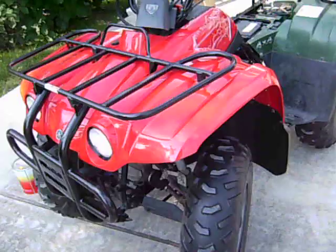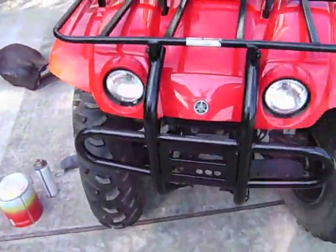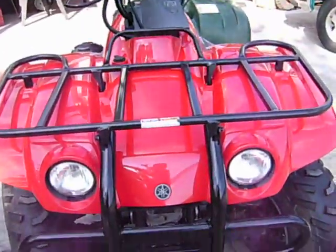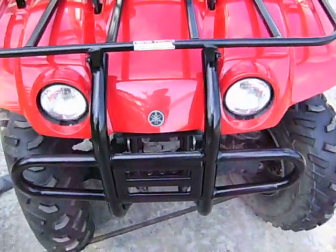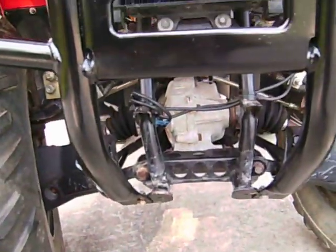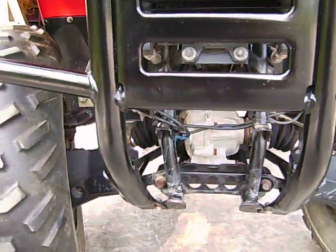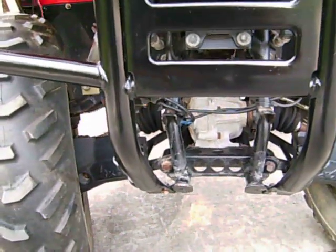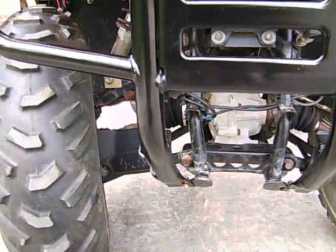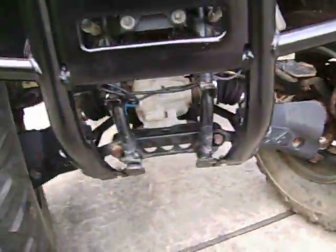I got a chance to put the plastic back in — I got it in and I think it turned out pretty good. I painted the front bumper and the rack black; it used to be gray. I still have to put the little skid plate back on. I was having problems with my brakes locking up so I bled them — I'm going to change the fluid. It's working fine now but I'll go ahead and change it since the oil is probably really old.